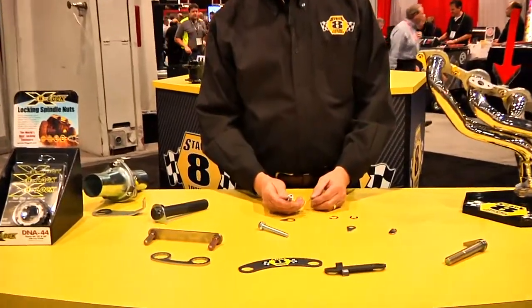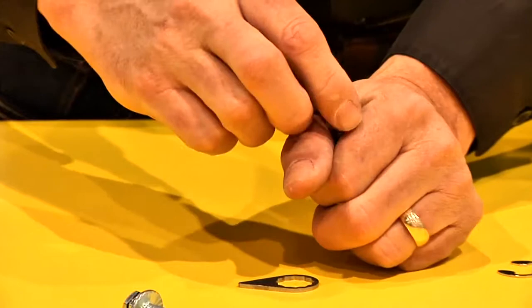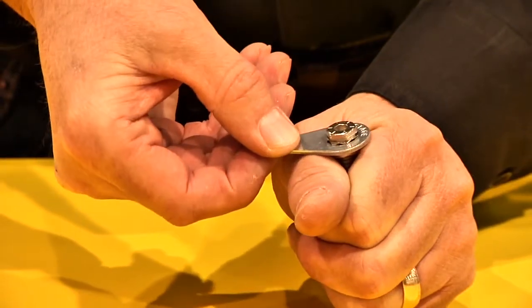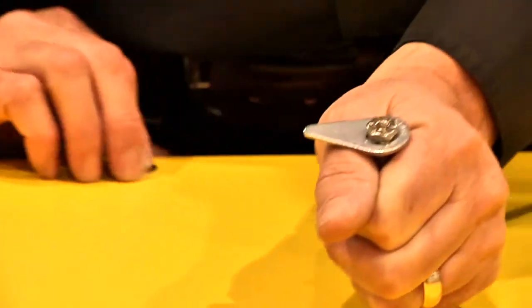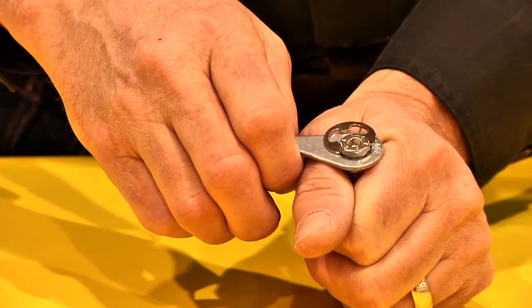I have here in my hand a header bolt. The way it works is by putting a groove in the top of the bolt. The bolt goes in and gets torqued to spec. A locking retainer specific to the engine goes over the top of the bolt just like a box end wrench. It goes up against the tube of the header, and then you simply take an e-clip and it goes right into that groove to lock it. It cannot loosen because it's a true active mechanical lock.